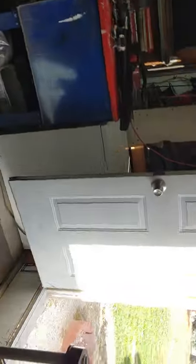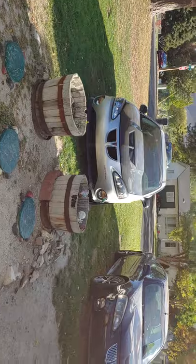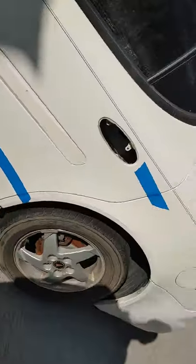I need the 10 in my other gun, too, because we're going to do the same thing we did on this one, on the other door. So, 10 millimeter and a T30, grab that. The T30 is for the side of the door locks. The 10 is to get the door handle off for better clearance, and you can see better.